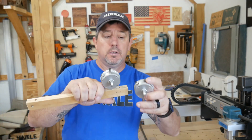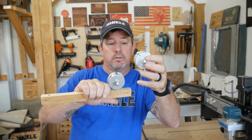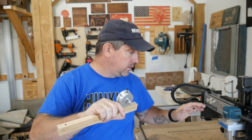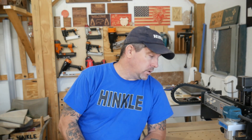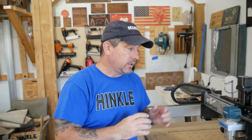In the case of the Shapeoko, when this thing rises up a little bit, the post won't go underneath the bar. So I took it over to the disc sander and modified the top just a little bit — you can see this one is way narrower and shorter. I did that until I was able to slide it underneath the axis and it fits. That's how you tram your Shapeoko or any other CNC — the concept is the same. Twist it until it gets into correct alignment on all axes. I hope that helps somebody; thanks for watching, please like and subscribe.